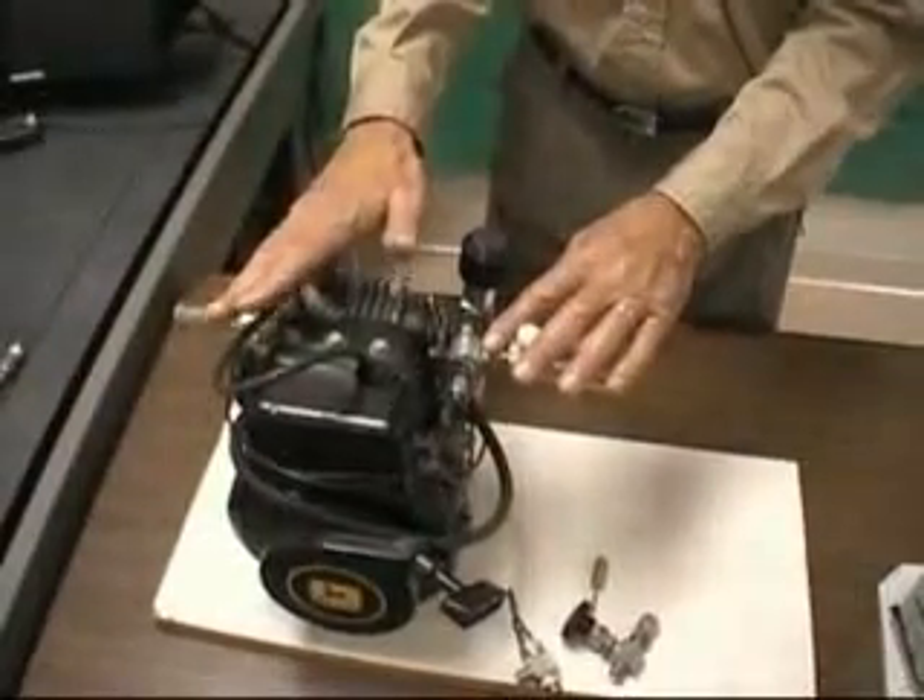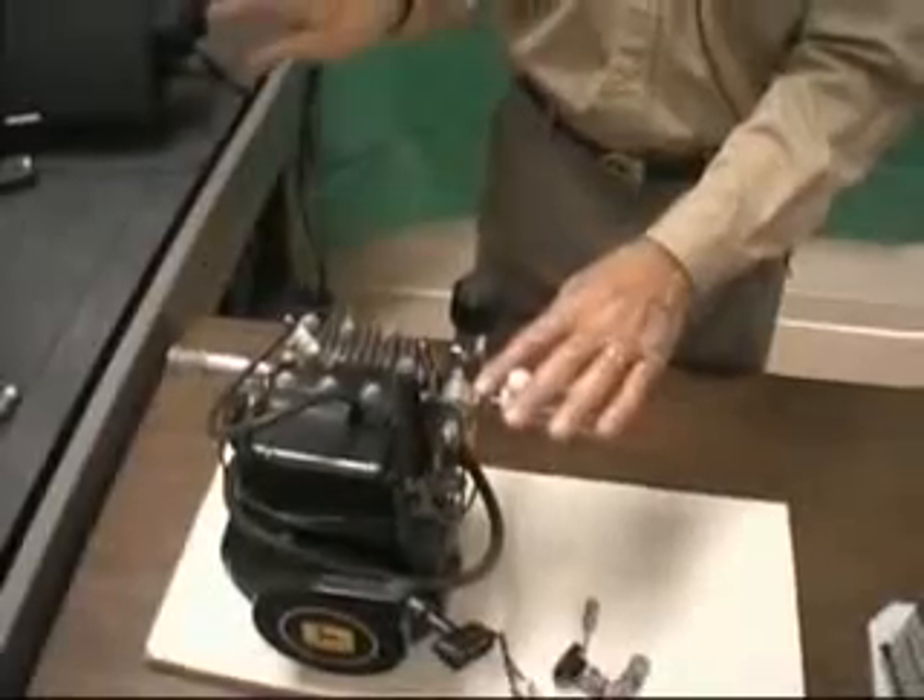You can also make an ignition delay circuit out of a Radio Shack 555 integrated circuit. Performance automobile shops carry a variety of brand-name ignition control systems, though ordinarily they're made for engines burning slow-burning fuels such as gasoline or methanol. Here we're making it so that we get much higher thermal efficiency and greater use of the fuel — producing more power by making a later ignition, because hydrogen is a much faster-burning fuel.